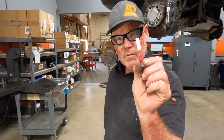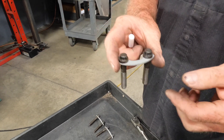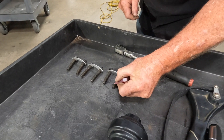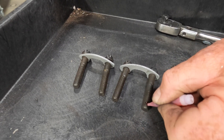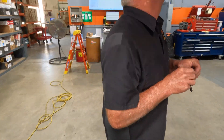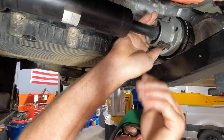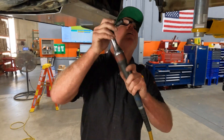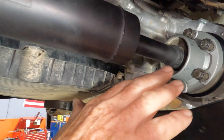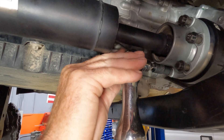The kit is also going to be supplied with some red Loctite. We're going to reuse the factory retainer spacer but put new hardware in it. Just a little bit of red — doesn't take much. Now we'll go ahead and line these up and throw it back together. We're going to run in the new hardware — all started by hand. Make sure that the spacer is fully seated before you tighten anything down. Bring it up evenly.